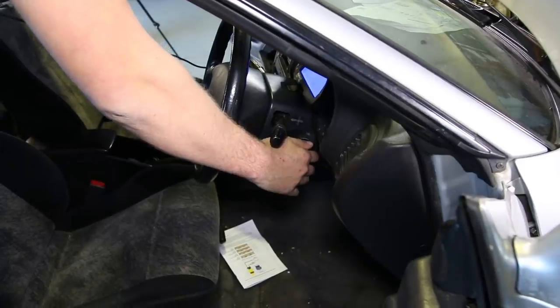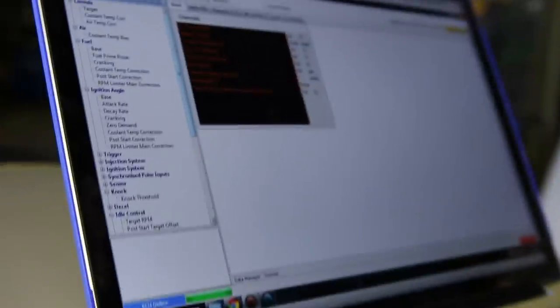We're going to turn the fuel off and disable the injectors, give it a crank, and see if the trigger system gets interpreted correctly. If it does, we can use the timing light to check the ignition timing. Ready for its first crank? It's alive! Sort of. It already sounds awesome - sounds like it's got compression. We've just given it a crank and found that the trigger signal is not synchronizing yet. So we've just swapped the two inlet cams back to front - we may be picking up to synchronise off the wrong inlet camshaft. We've swapped it to the other camshaft and we'll see if it decides to synchronise.